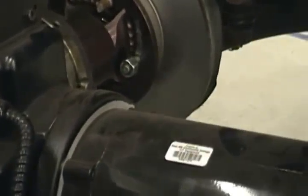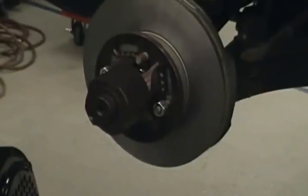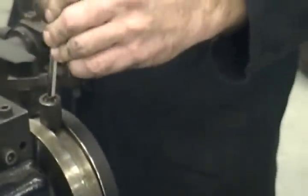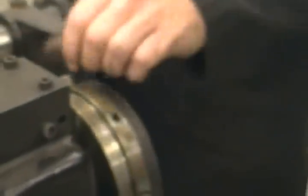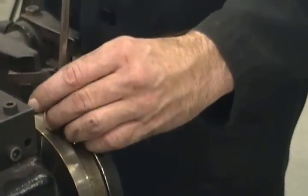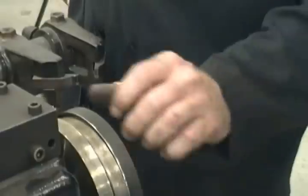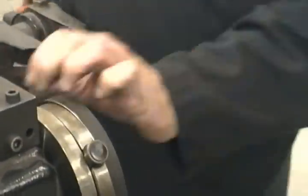Slide it off. Now, as soon as it's off, I like to get in the habit of going ahead and breaking my calibration plate back loose. Spin it around. I usually come all the way off with this to where it's at the point that it will spin. Make a couple of rounds with it, make sure everything's good, come back to the top. What do I want to do now? Screw it down just enough so it won't spin. Just enough so it won't turn, that's right. I'm safe right there. Everything's loose. This part of the lathe is ready to go to the other side of the car now.